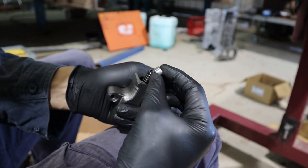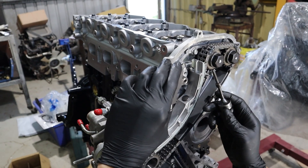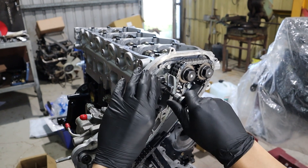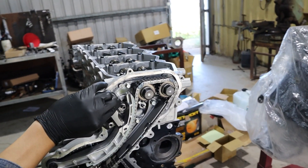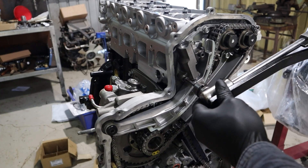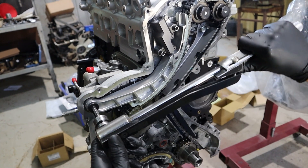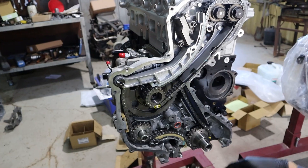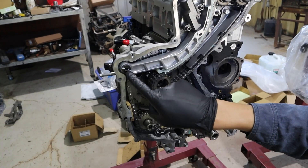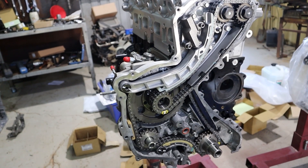Put the plunger back into the tensioner. Install the top tensioner — put the top screw in first a couple of threads, then twist the tensioner around to get the bottom screw in. Torque the bolts to 10 newton metres. Tighten up the guide bolts to 23 newton metres. Final check on the top: chain links match with the sprockets, guide bolts torqued, tensioner bolts torqued — all good.